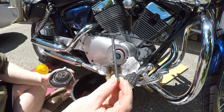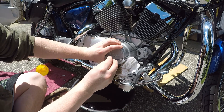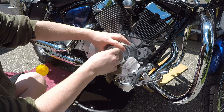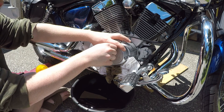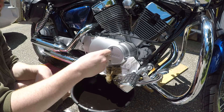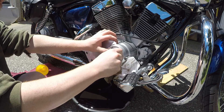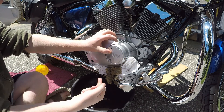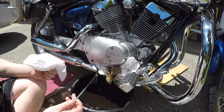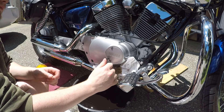Don't forget to put a little bit of old oil on the new gasket to help it seat better. When reinstalling, make sure to have the Yamaha logo oriented the correct way. Grab the longer bolt and put it into the right-hand side and thread it in hand tight. Do the same with the other two smaller bolts on the bottom left and top left. Grab your allen key or allen key socket and tighten them all down until snug — one of the many reasons to have a magnetic pen. There is a torque spec, but once tight, a quarter turn seems to work.